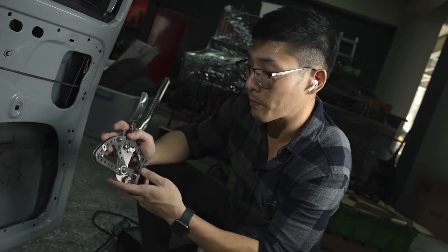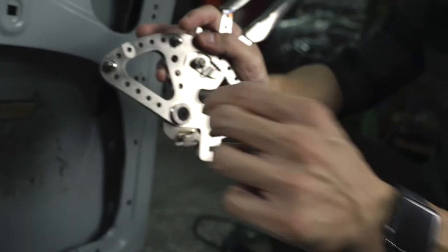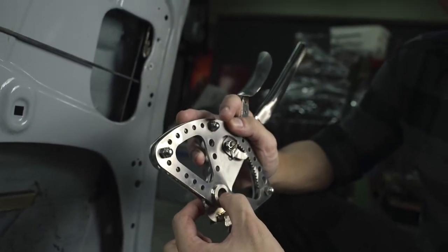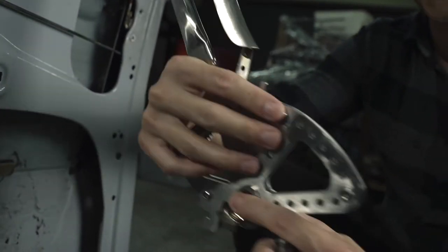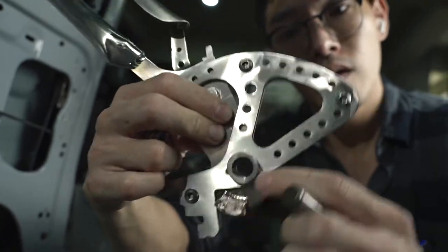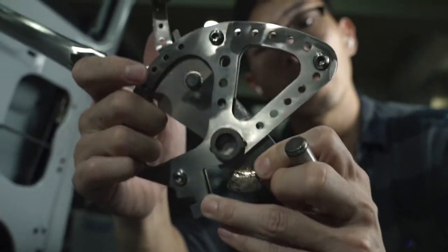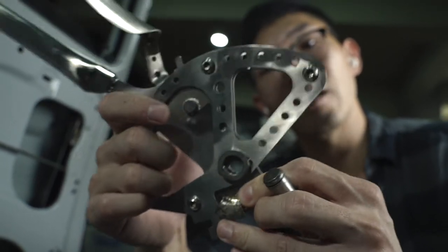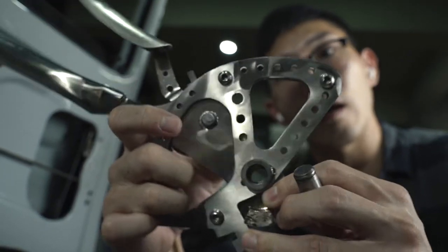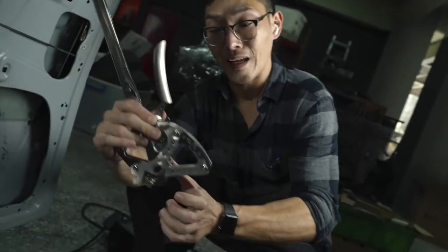Now, prior to actually installing this onto your Beetle, you're going to have to remove this part, okay? This pin over here. And then you'll have the assembly point in the Beetle where it'll sit in between, and the tube. You have to put these two pieces over here. They need to match up. You see, they can get kind of misaligned. You have to make sure they align up properly. And then once you put it into the socket, then you put the pin in.